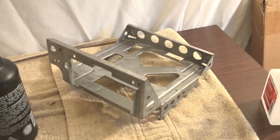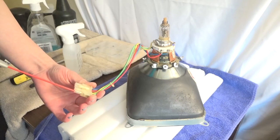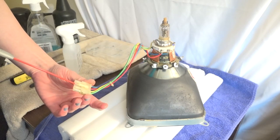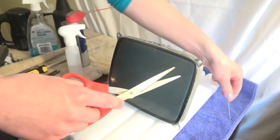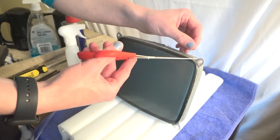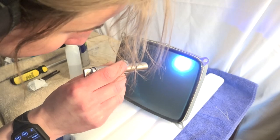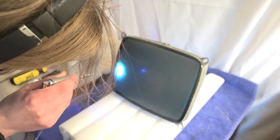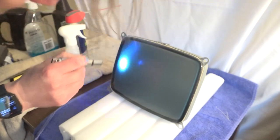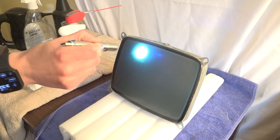And while it's not perfect, I'd take it over what we had before. Next, I'm going to clean off the CRT and spray the yoke connector with some contact cleaner. I also wipe down the front of the tube and cut these loose strands of fabric, trying my best not to unravel them further. I also checked the tube for burn-in, which to my surprise it had virtually none. Given that this is a very early compact Macintosh, plus the fact that it had at least some institutional use at Drexel University, one would think it would have at least a little bit of burn-in. But at a cursory glance, I can't see any. Perhaps this tube was replaced at some point as well.